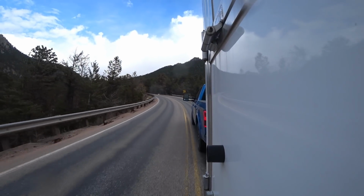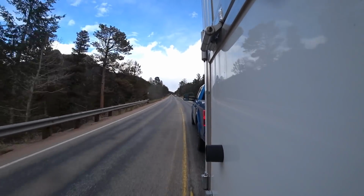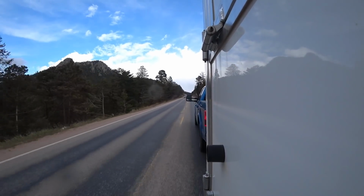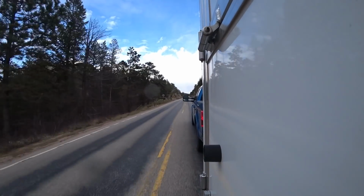But I know that wind was hitting me so hard, and the steering on this is trying to save you all the time. I had to keep watching the trees and how much wind there was, so I could decide what the movement was. It was the wind, and it was doing okay, but I had to hang on to it. I couldn't just daydream like I normally do. No, it's good, and using the weight distributing hitch with sway control is a very good idea. It's not so important in the heavy duties, but it is important in the half tons and the mid-size. They all need a little bit of help controlling that trailer.